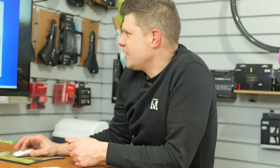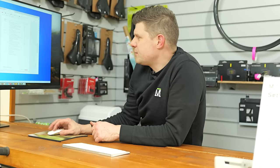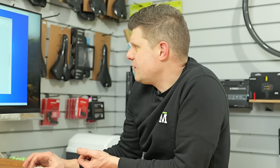Drive unit, check that the design cover is fitted correctly and not damaged. Check that the drive unit is secured properly to the frame interface. That means all the bolts are at torque and all those little mounting plates that we showed you are all fitting fine. Crank fitting bolts are good. Contacts and cables are all clear of damage and dirt like we showed you, and carry out a function test on the chainring holder and lock ring.